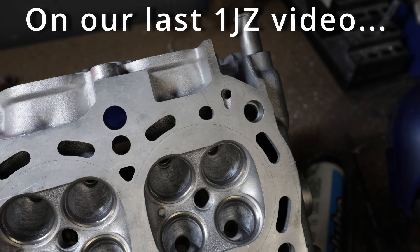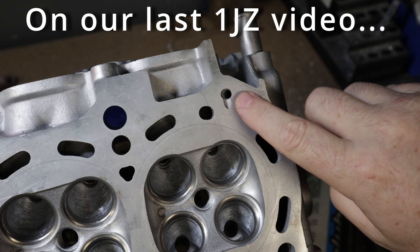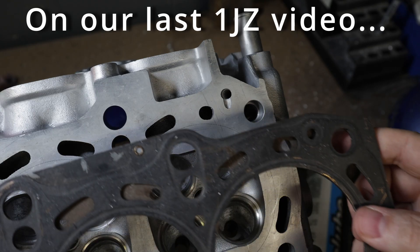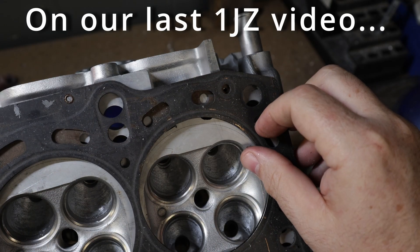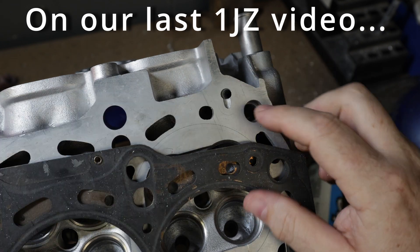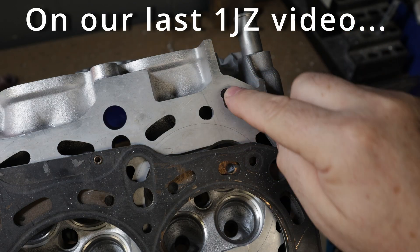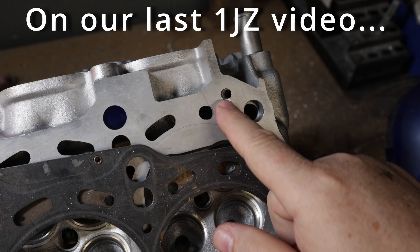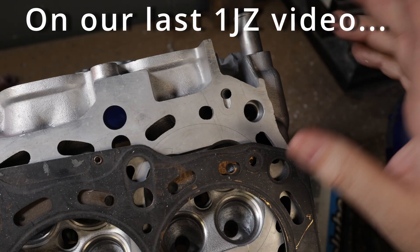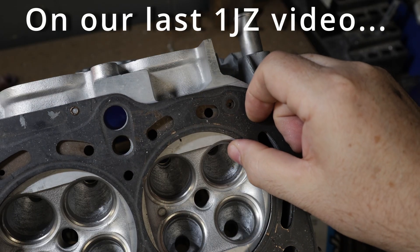I'm not going to show the process today, but I wanted to just touch on this oil hole right here. This oil hole feeds the cylinder head — the top of the cylinder head — with oil. This customer brought up how guys do a swap. This is a 2JZ head gasket, and this is the oil hole right here, and the oil hole doesn't match this oil hole. So basically we have to move this oil hole this way, move it down, or make this a better path. That's going to be for the next video. We're going to figure out how to make this hole fit the 2JZ gasket so there are no oil issues.